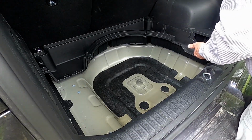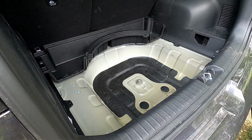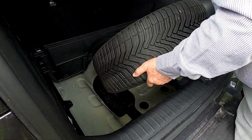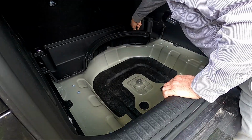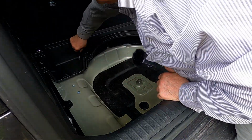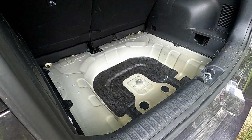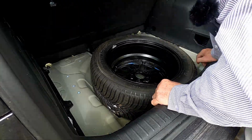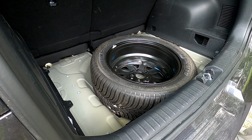Following in ATS's rapid working system, I now demonstrate removing the panels and try again to fit the tyre and find that the front panel prevents it from going in. So 4 more screws removed and we'll try the tyre, and it sort of goes in, not terribly. The retaining bolt is not long enough, and as I say, the wheel rocks badly. It certainly doesn't get to the bottom of the well designed to hold the spare wheel.